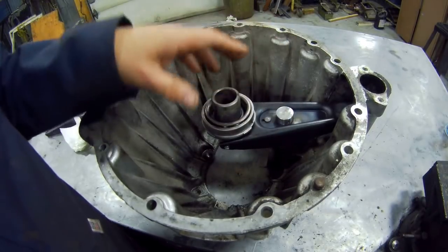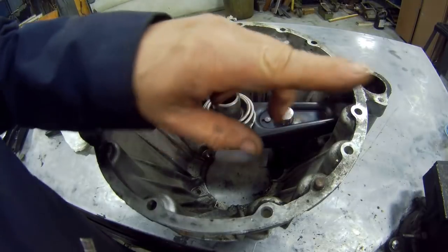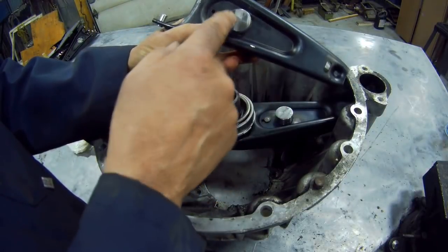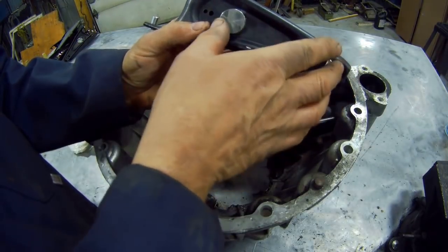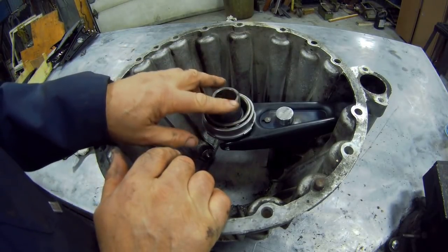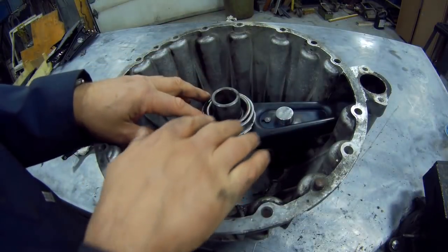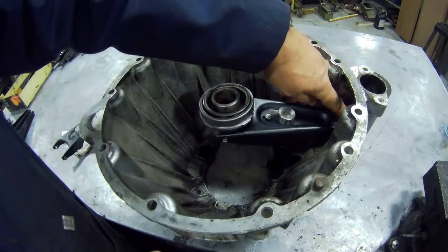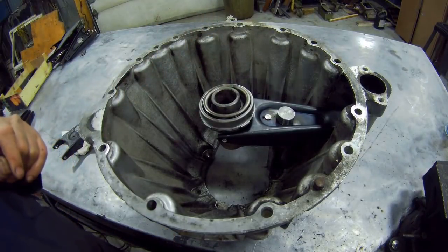A little bit of mathematics: the length of the arm here to here is about one and a half to one — so the ratio is about 1.5:1. Technically speaking, if you want to press the clutch in with 50 pounds, you only need 33 pounds of pressure on your cylinder. That's why it's not in the middle — it's geared up, but the stroke is longer. To push this down you have to travel further than this will go up.